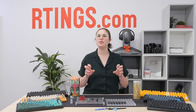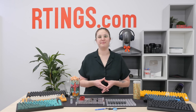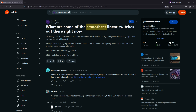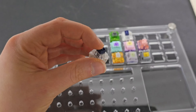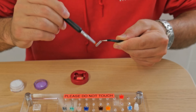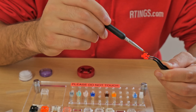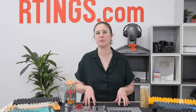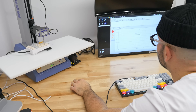How do you determine what a good switch is when that's different for each person? The first place to look is in the description. Smoothness is a word that comes up frequently when people search for and discuss switches — it's usually positive, the antithesis of the negative, scratchy feeling. The spring or plastic components rubbing against each other in the switch contributes to this unpleasant, scratchy typing experience. Some people are so opposed to it they'll spend hours putting lube on their switch components just to avoid it. We don't lube any of our switches before testing — that would take way too long and potentially skew the results, plus it wouldn't represent how the switches feel right out of the box.